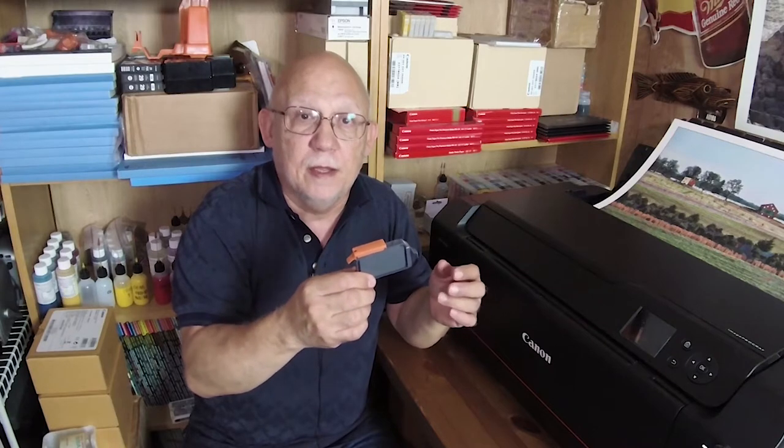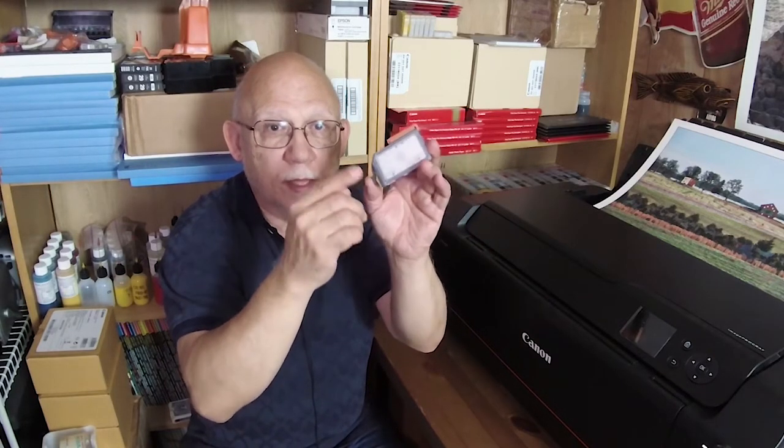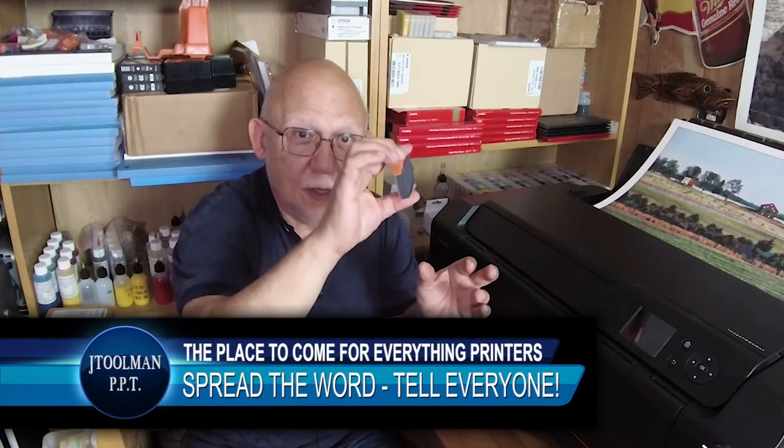You want to keep that sponge free of trapped pigment particles, as this will prevent a whole bunch of problems down the road. It can creep up on you unexpectedly, and before you know it you'll have huge problems. The only remedy, if you haven't already harmed your printhead, is to replace the cartridge with a brand new one. Make sure you drip ink over the whole surface of the sponge to back-flush and reintroduce any dried ink accumulated on the corners back into the cartridge's internal space.